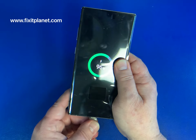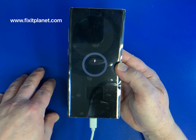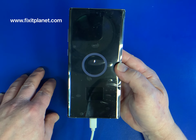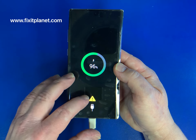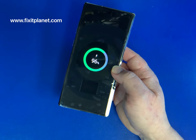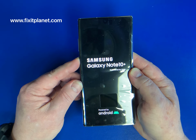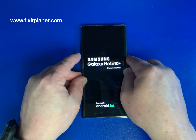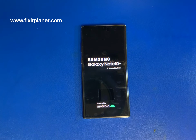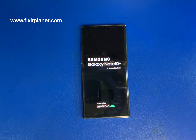Now there's an exclamation point down there because the back's not on, and this cable is probably no good. I'm pretty sure the cable in this case is the problem, not the back. Usually the antenna caps, if they're not in place, you might get it overheating or some other message. In this case, that cable is bad, so I'll bring another cable over later, and we'll use that.